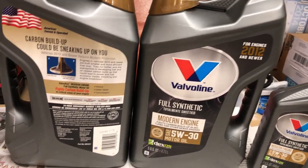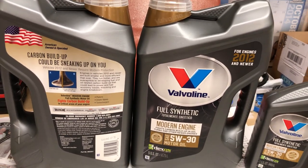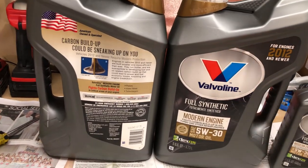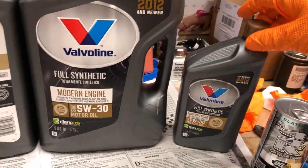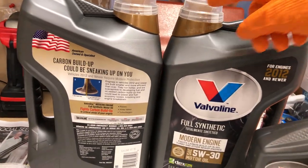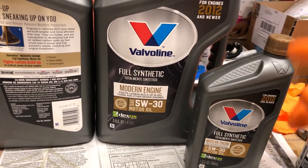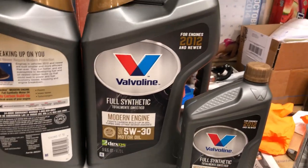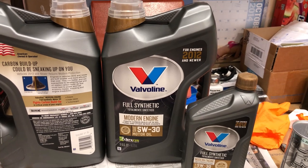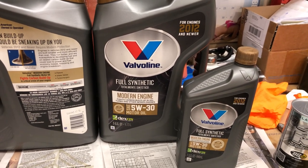This takes 6.87 quarts according to the manual, but I'm not going to put in 6.87 quarts because I don't know if that's the oil change amount or the maximum capacity. I'll put a full five quarts in, then add a separate quart, then use a partially filled quart to top off — aiming for 6.5 to 6.6 quarts. I'll run it, shut it off, check the dipstick, and keep an eye on it.